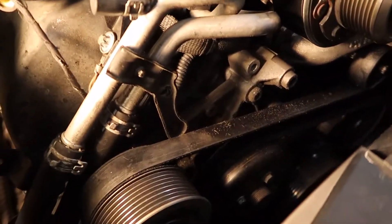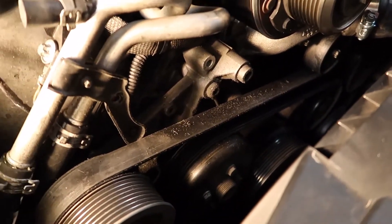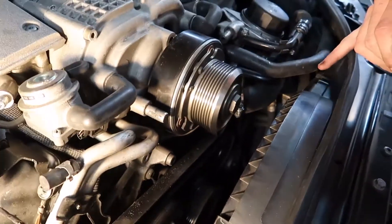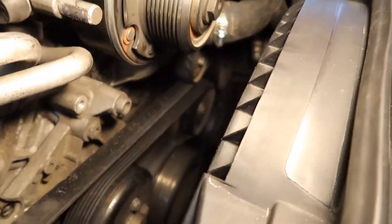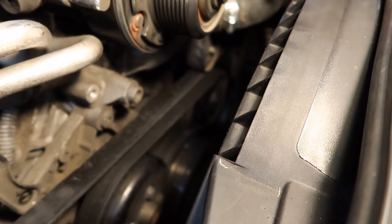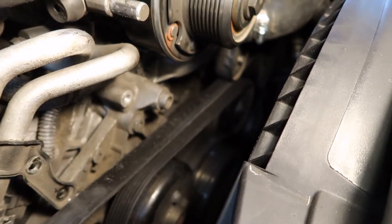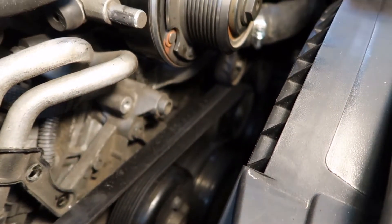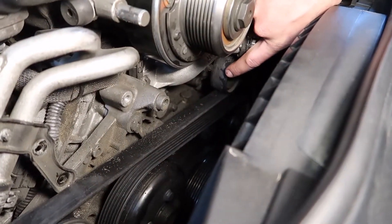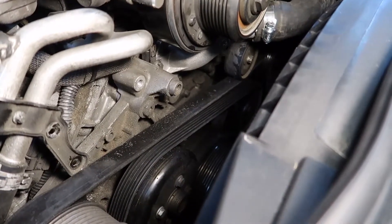Let's take a look in here. That looks pretty good. Well, that belt's got all kinds of crap, we need to clean it off. We're going to replace it too, but I'm going to clean it off when we're done. Here's the thing — the oil filter assembly housing over here is leaking, and it's actually dripping on one of the pulleys down there and on the belt. So I figured we'll get that fixed, and then afterwards we'll put the new belt on, that way we don't have any gunk on it. Look at that pulley — all the garbage on it. There's a lot of stuff on there.